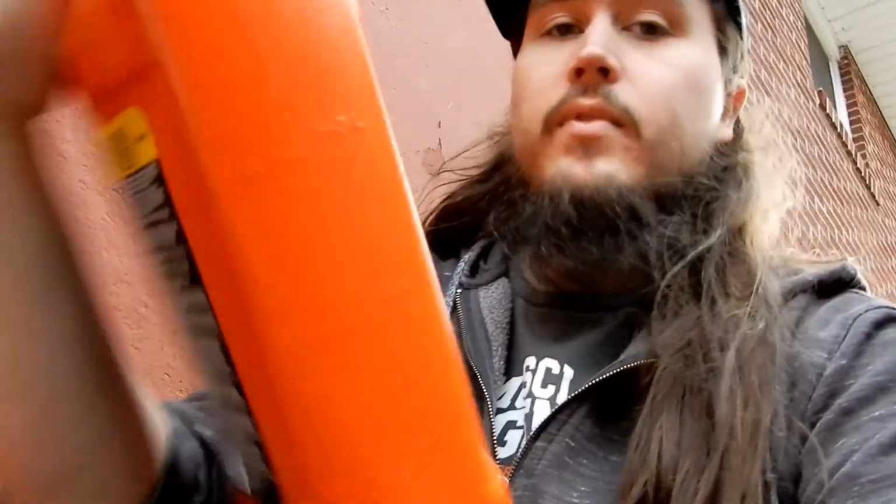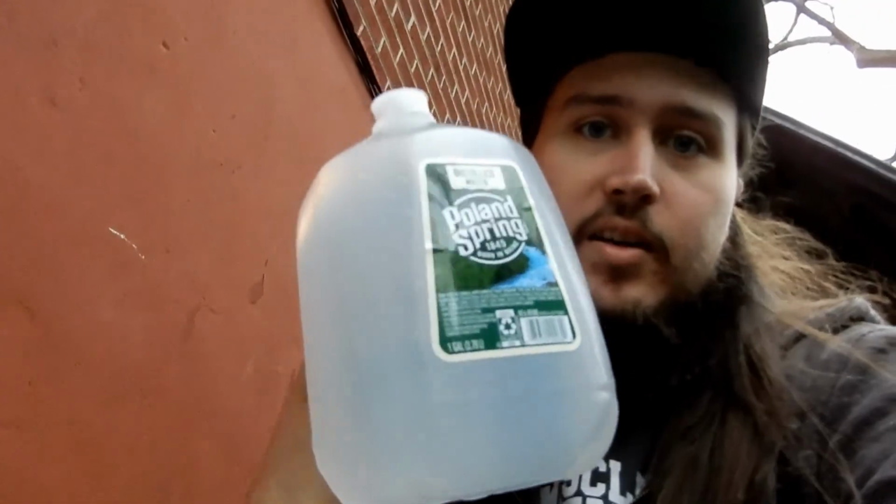So this is what I did. This is what I put in. I put in full strength AutoZone coolant. It's just AutoZone stuff. And then I mix it with distilled water. Don't use this crap that comes out of your tap. That's why I had to make this entire video.